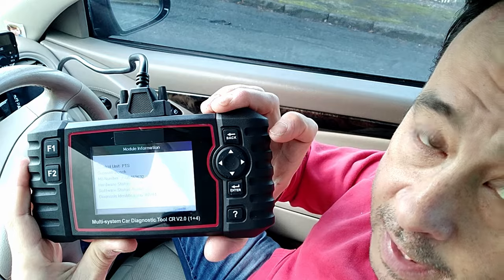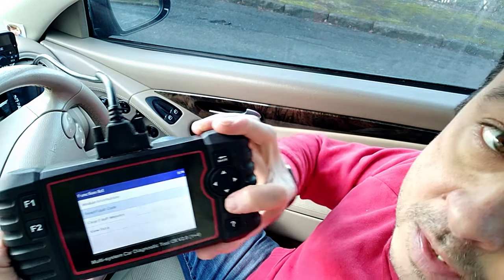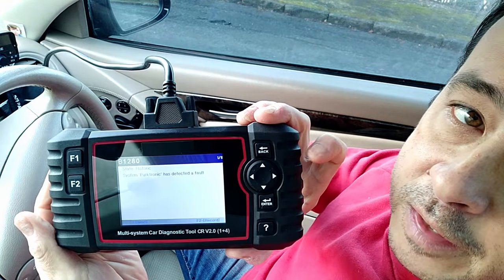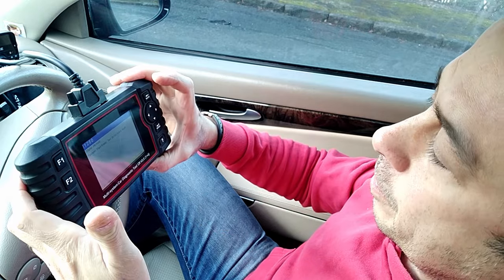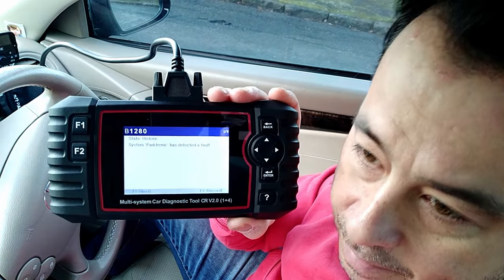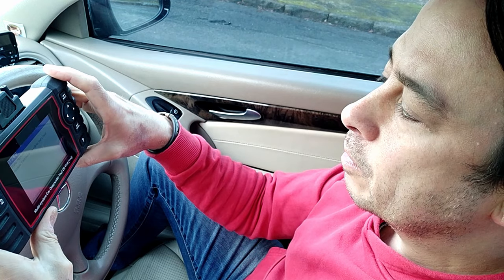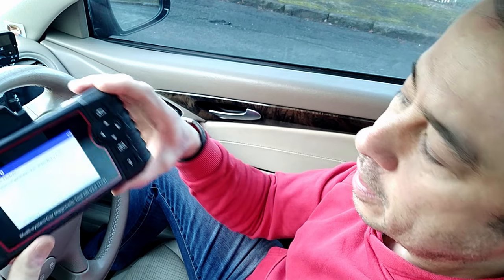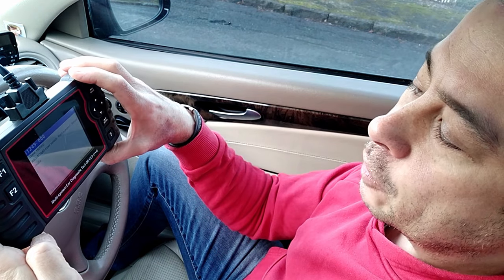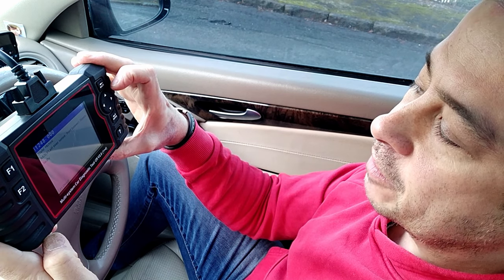You can record that information if you need it for a later date - I just sometimes take a photo on my phone. Now the bit you want is to find the fault codes - Read Fault Codes. So let's go into that and see what it says. At the top here there's a fault code that's popped up - one of eight. Don't always panic when you see that, because quite often when one fault happens it has a knock-on effect with other things - ABS will knock out your cruise control, for example. So it says the Parktronic system has detected a fault. There's A42B, right inner sensor, front bumper sensor is faulty. A2B, left inner sensor, front bumper sensor is faulty.